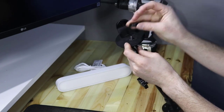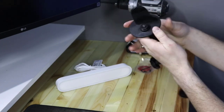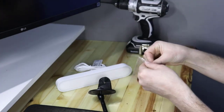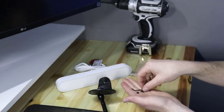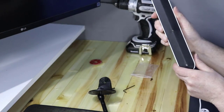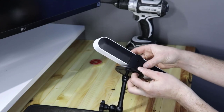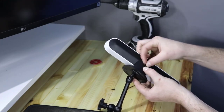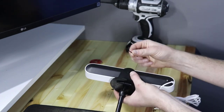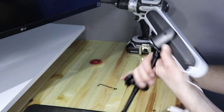Take the top post of the camera mount, slide it through the hole you drilled on the play bar stand, and screw the threaded adapter back onto the post. Make sure you have this tightened down firmly so it doesn't move later on. Then grab the 3M tape, small screw, and allen wrench from the baggie. On the back of the play bar you'll notice two screw holes where you can mount the play bar to the stand. I mounted it to the center of the bar, but whichever hole you use is up to you. Line up the screw hole on the play bar with the hole on the stand and screw it in using the allen wrench and small screw. And there you go!